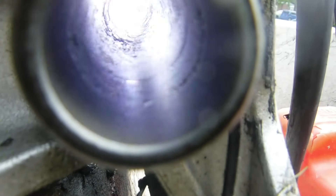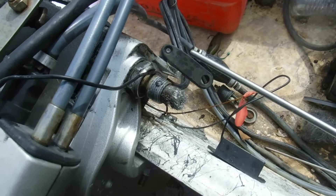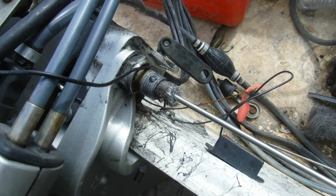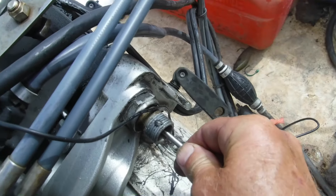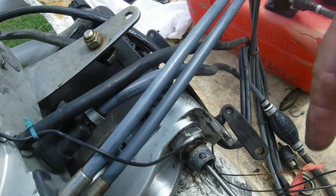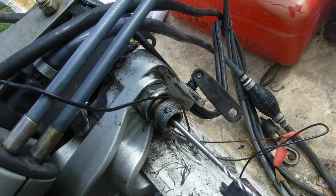I'm looking inside the tube and there are a couple little pits in there — looks like some corrosion has built up. So we need to get in there and clean that corrosion out before we re-grease it and stick it back in. It wasn't really that bad. We're going to take some steel wool, push it through this way, then take a rod and push it the other way, and just run it back and forth to clean the inside out.